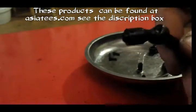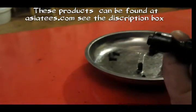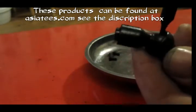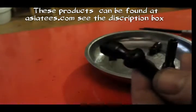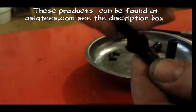And once the pin's in, and you've got it all lined up so the flat spot is the same size as the set screw, stick your driver in, butt the set screw down, and that's it. You've got one end done, nice and tight, no play.